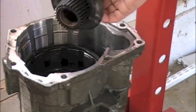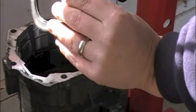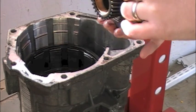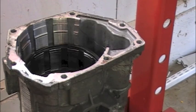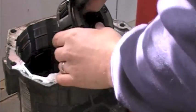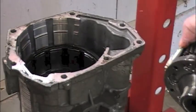Other parts in here: overdrive sun gear, thrust plate, thrust plate, and this is the thrust plate bearing. This assembly actually sits directly against the overdrive planetary. We do have the new thrust plates and bearings on the website, part number 12220. Those are replaced about 80% of the time, because the plate itself under that high pressure will have a tendency to warp.